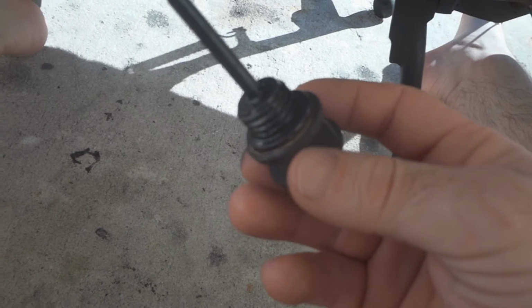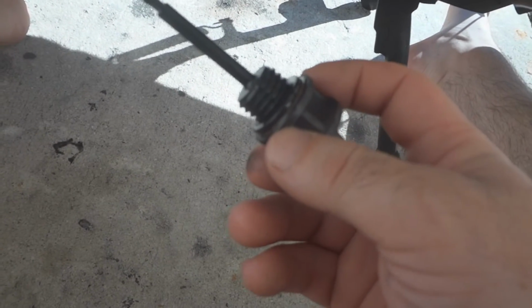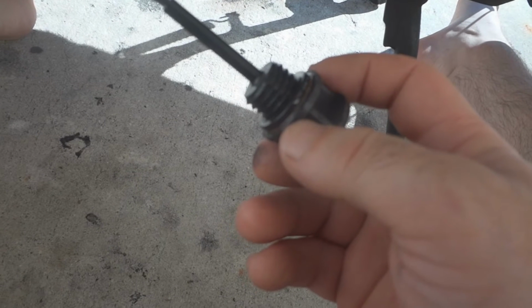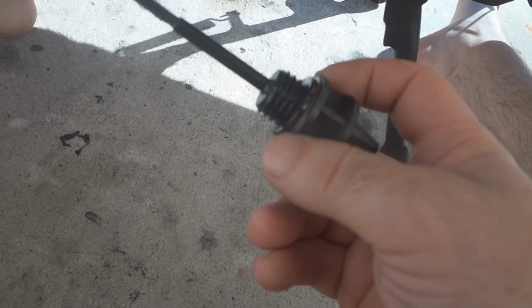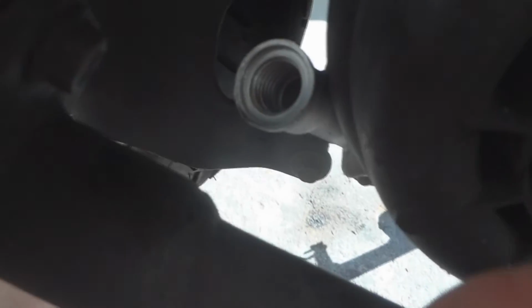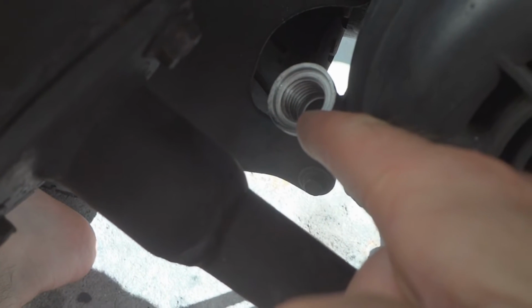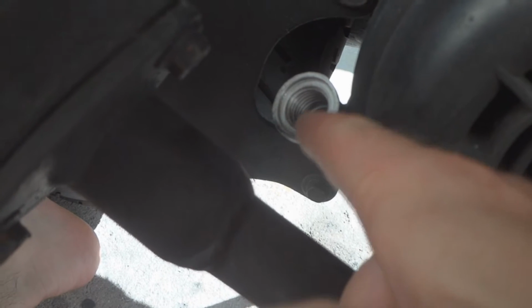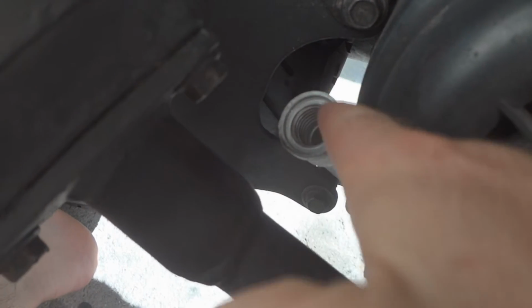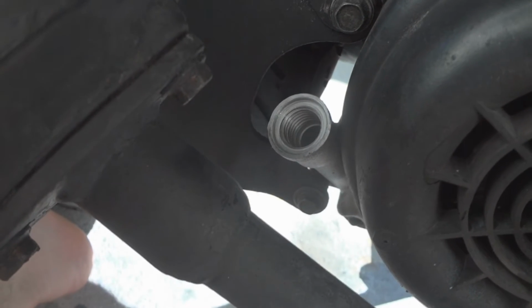You take the two gaskets that you cut out and you put them on the oil cap first. Then you put the rubber seal on last. And over here, the problem is, in my opinion, these rubber seals aren't thick enough. And what happens is when you tighten the cap on, the plastic will mesh against here on the aluminum, and it doesn't allow it to go down enough for the rubber to form a seal.